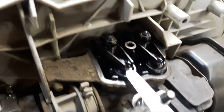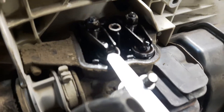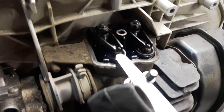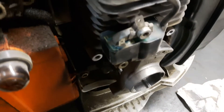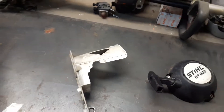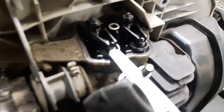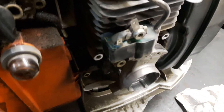Unfortunately they have one drawback — the exhaust valve and the intake valve need to be gapped every certain number of hours on an interval. You can usually tell it's time when you try to start the blower and on compression it jams up really, really tight and you really have to yank it over to start it. When these are adjusted properly there's very little pullback on the recoil and they're really easy to start.